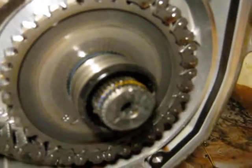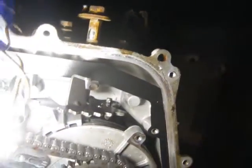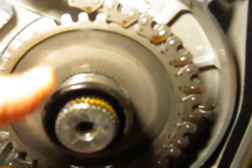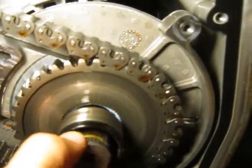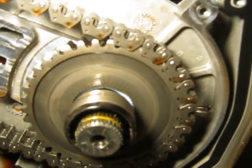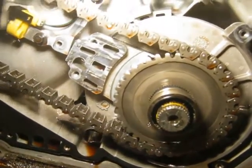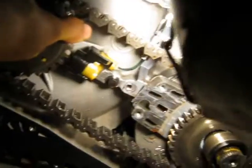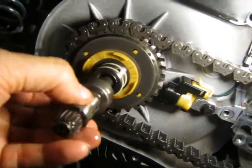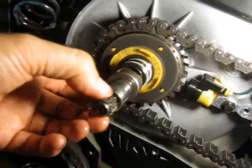See where the driver side axle goes in. I'm going to hang this light here and give it a little spin like I was doing earlier. This axle here turns independent of the gear. The gear's on a spline because it slides out. I'm surprised there's like no chain tension or anything on this. This center shaft comes out — I guess that's the drive shaft for the front pump.